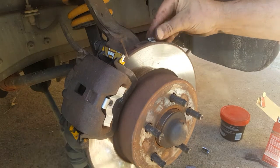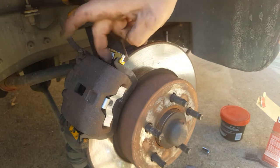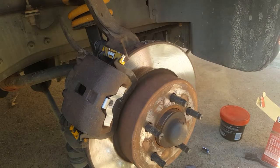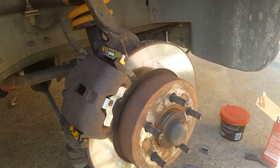Okay. Bolt's back in. So there's my plates there. The reason why I curve the ends over is just so it doesn't slip out. It's just packing, and it stops that clunking noise - it makes a little banging noise when you press the brakes if they're not in there. So tighten up your bolts, put your wheel back on - job's done.